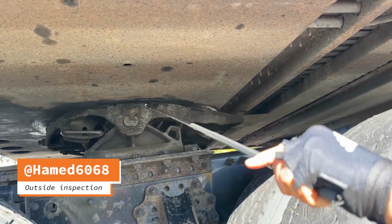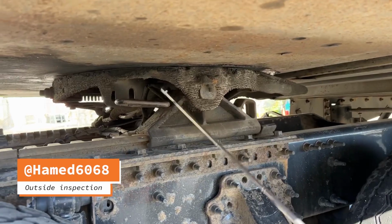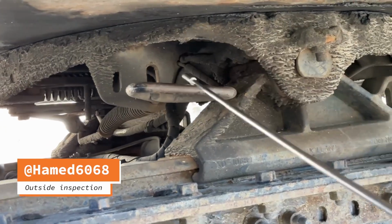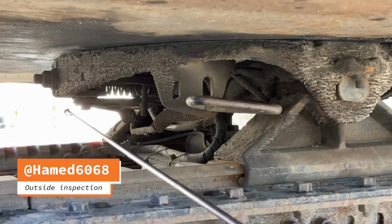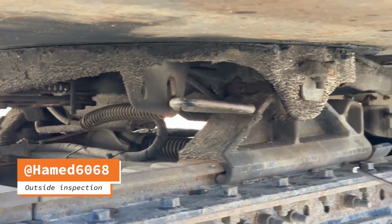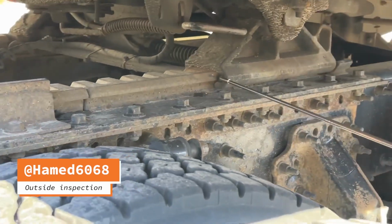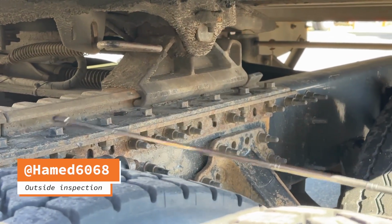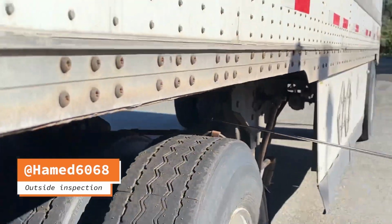The pin and bolts are secure and not missing. Release arm is in engaged position, secure, and safety lock is in place. Sliding fifth wheel locking pins are not damaged, and the pins are fully engaged. After that, we have to go inside,